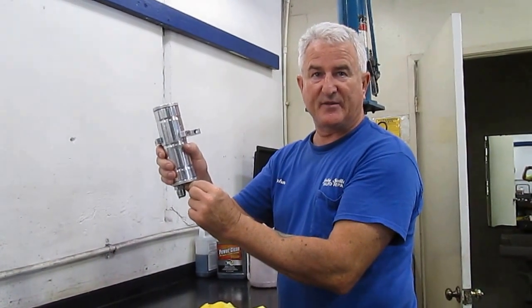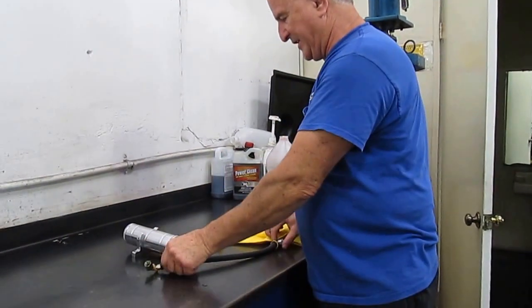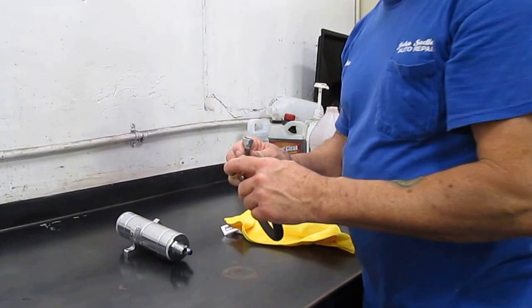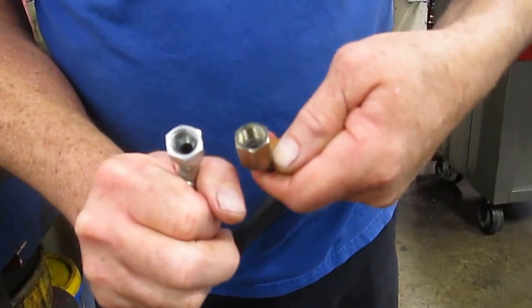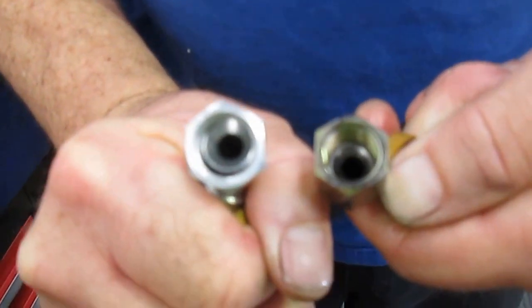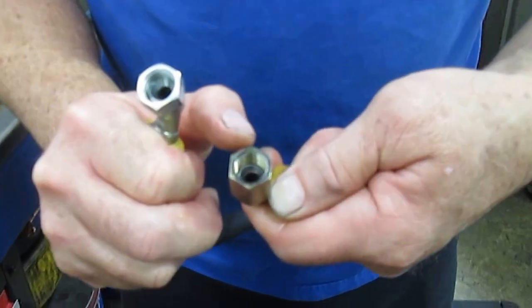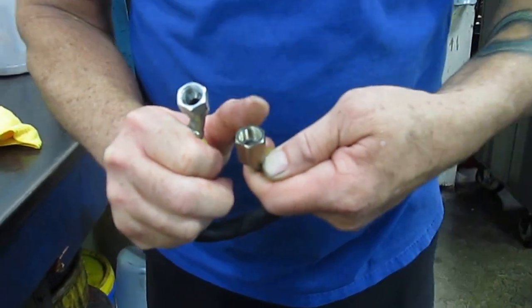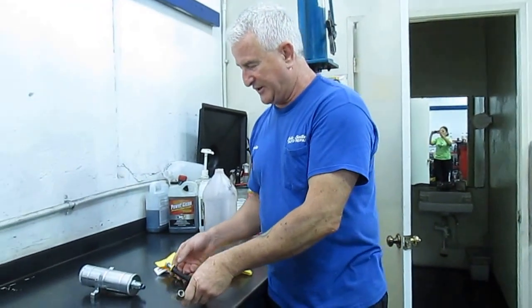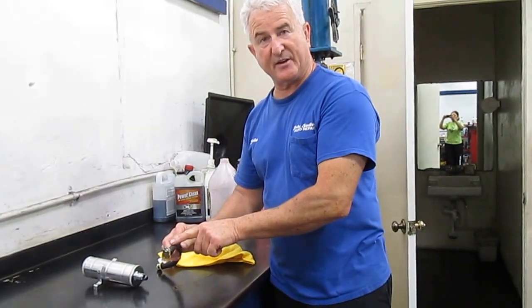So when you're dealing with these kind of custom issues, the best thing to do is just take the whole thing apart, take it off the vehicle, look at both pieces. You'll find a difference in the way those flares are designed inside there. One of them's got a much bigger, wider, broader area, and one of them's a smaller area. And the smaller area, you can see that it doesn't have any edge where the lip meets around it. I'm not explaining it quite right, but it doesn't have a good seal on that outside edge, so it's just enough. You drive the car 5 or 10 miles, and you have a nice little bit of fluid coming down the back of the hose.